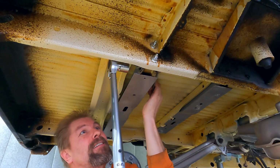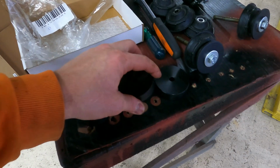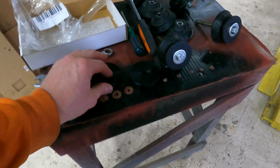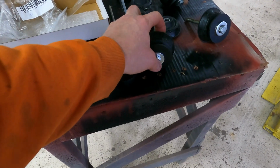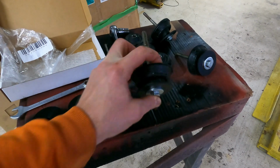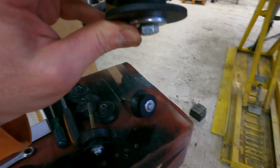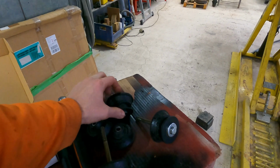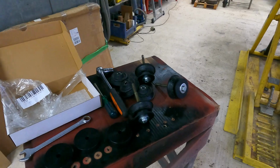Yeah. So I have this lift kit, or rear diff lowering kit actually. And this lower piece goes to the front and the higher piece to the rear. And the new bushings and the washers painted. And in one place there is a special washer because the bracket is one-sided. And so let's try to install the diff.